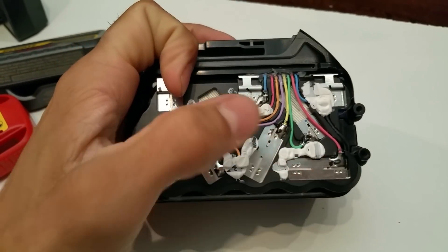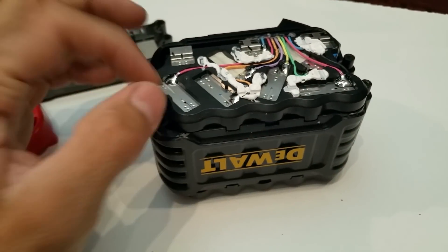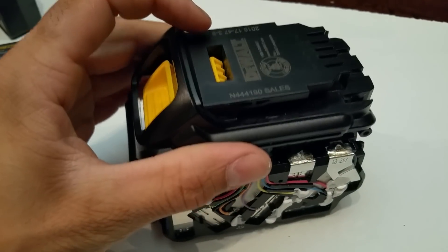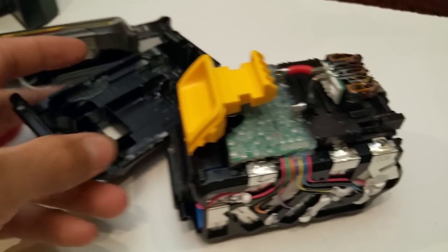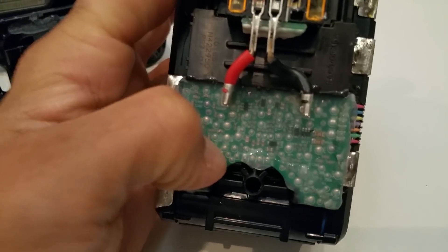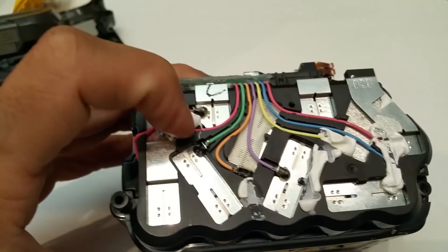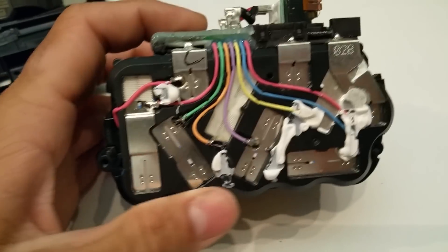That's why I would assume all these wires go to their individual packs, which monitors the inside of each cell's voltage and reports back to the motherboard here. Underneath this cap — which was really hard to take apart, basically glued on with silicone on the ends and took about 20 minutes to pry apart — underneath all this is your main motherboard, and it's coated. Everything here is coated in silicone, and the bottom connections are all dipped in what looks like a urethane sealant. You can flex it a bit so it's not epoxy, but the board is completely covered.